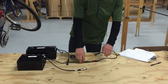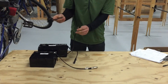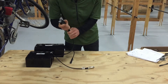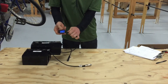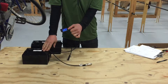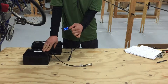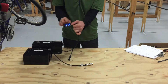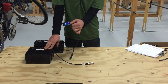To start with the voltmeter, you can plug it directly into one of our batteries. You line up the arrows, plug it right in, and you get a reading. The basics of the reading: this is a 36-volt battery, and you should see voltages on a lead acid battery of 2 or 3 volts above the nominal rating. So on this 36-volt battery we're getting 38 volts, which means it's just about fully charged.